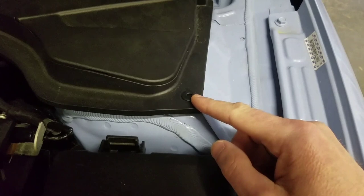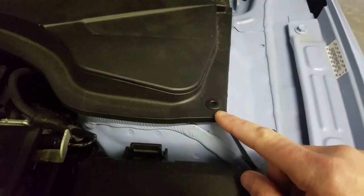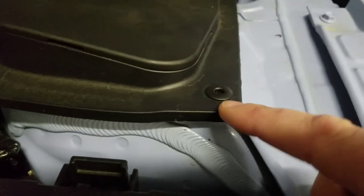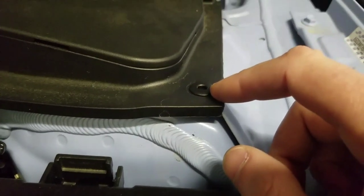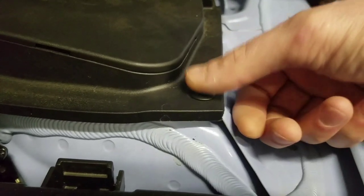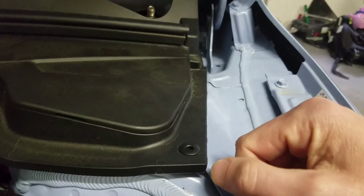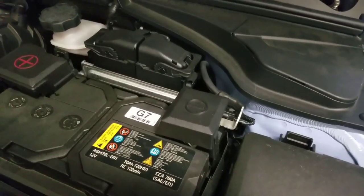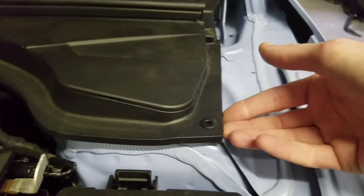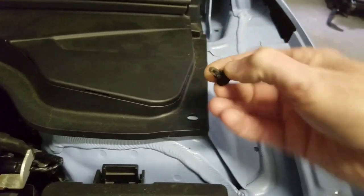Now we need to release the clip. The way I do that is I'll put my thumb over it and just kinda wiggle it out. You can go ahead and put a flathead screwdriver in between the two plastics and pry it up a little bit, but I don't like to do that - I don't wanna scratch up my plastic. The reason I put my thumb over it is: if you just start prying it up, this thing's gonna shoot straight up, probably hit here, and then go in the engine bay, and yes it would suck. So just put your thumb over it, put your fingers under here, kinda wiggle it, and it pops up. Take the clip out - it's out of there. Let's get the rest of these out.